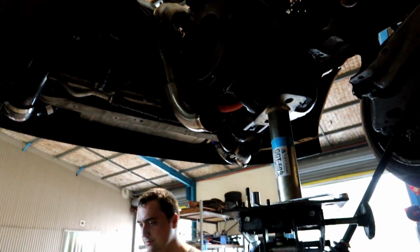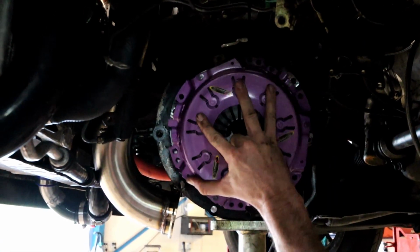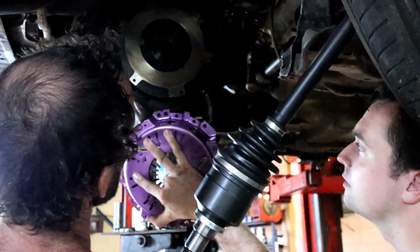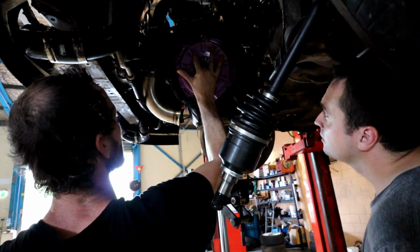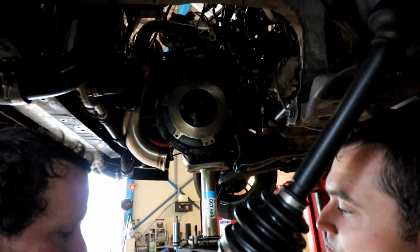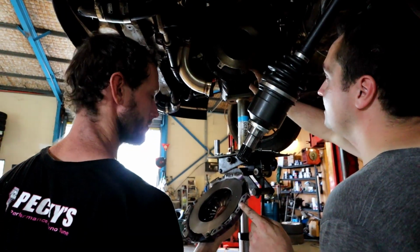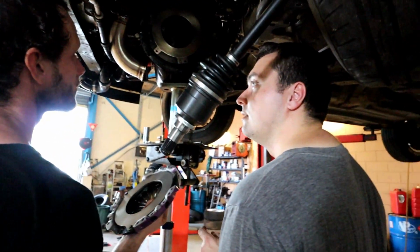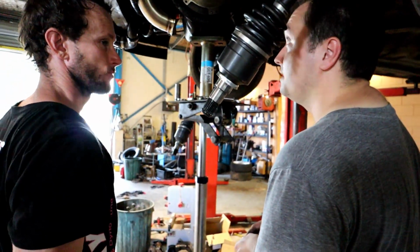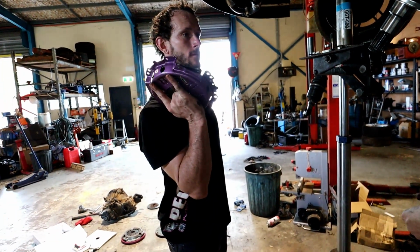These are the same rattle guns that I've used for years and they're all the same stuff as before. Just crazy that one time. What are you thinking? No way. I've encountered this issue before. That's a normal style, that's a stock Starlet flywheel, and that's an FTE flywheel. Remember that Mantic clutch? It was for an FTE, and I had an FE flywheel, and it was a different size. So that will only fit a stock Starlet flywheel, not an FTE one.